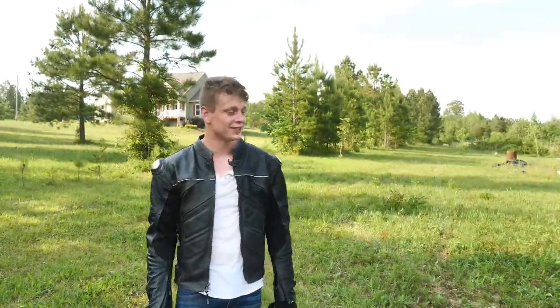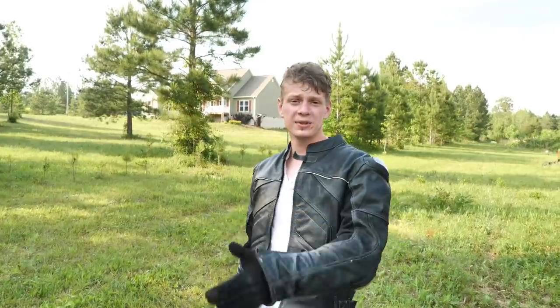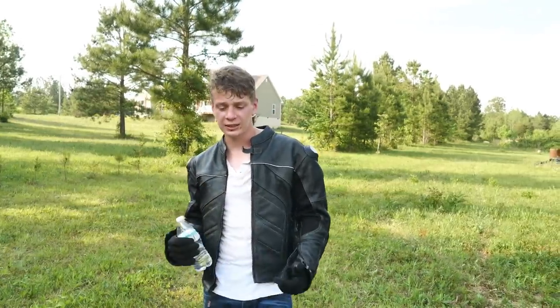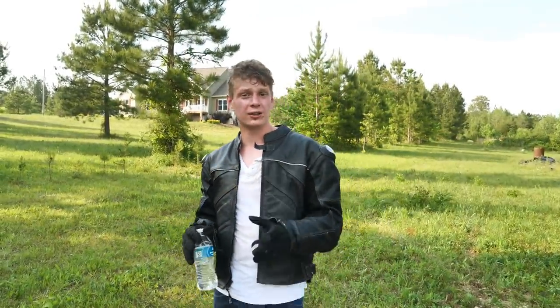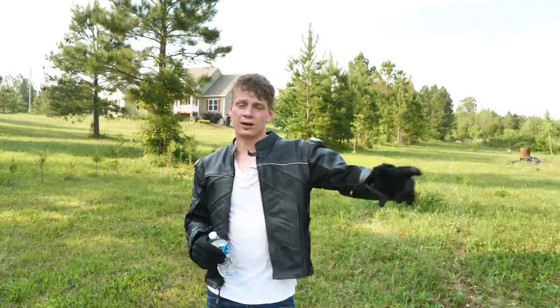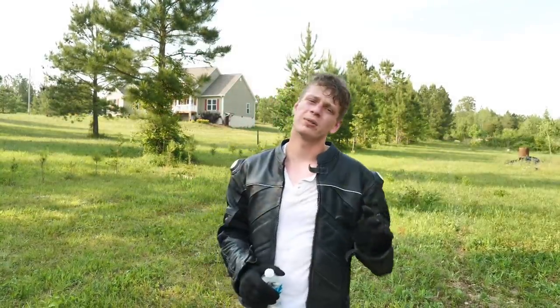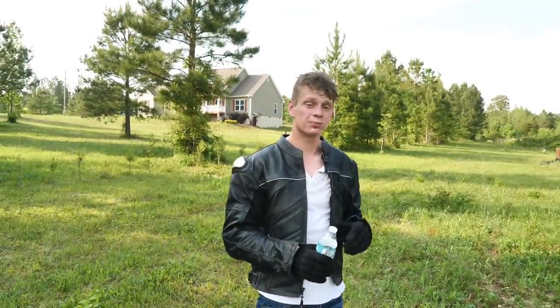The heat index is like 90 degrees and I forgot earplugs so I'm kind of going deaf right now. Caleb, the guy who donated this engine to me, set the clutching to be really aggressive — the engagement is at 5,000 RPMs. The gearing on this thing is really low, and I did it that way because I didn't want to get hurt on the first test drive. In case it runs away I don't go like 100 miles an hour, so it'll probably only see about 60 miles an hour today. But once we get more comfortable and stiffen up those shocks, because the suspension is pretty soft, we could see pretty fast speeds.